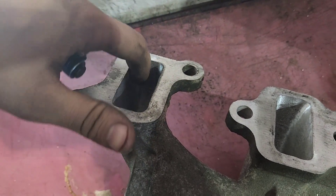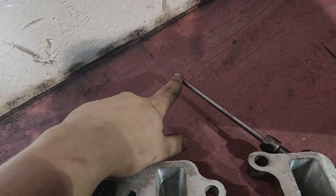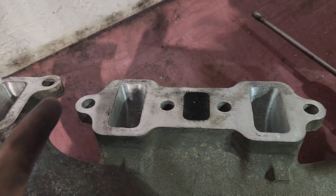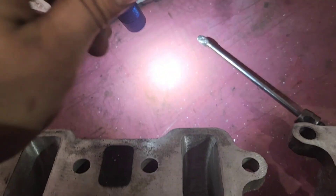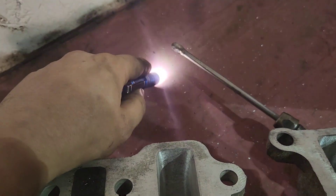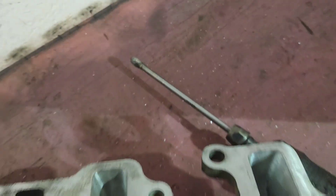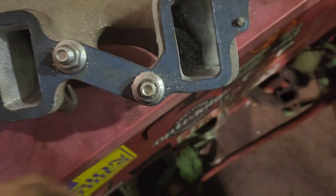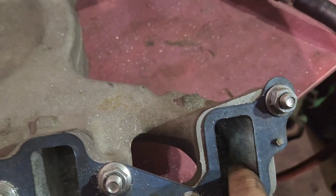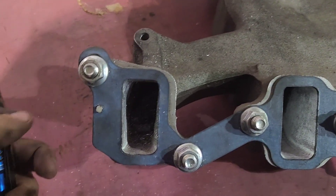Nothing. And that's due to the bits I'm using — this carbide burr. I started out with a non-ferrous burr, which is for aluminum, brass, things like that — non-steel. But then I'm finishing it up with this steel bit because it's a lot finer. You can see real small, fine teeth. That's what I'm using to get the sides cleaned up real nice after I roughed it in with the non-ferrous burr bit.